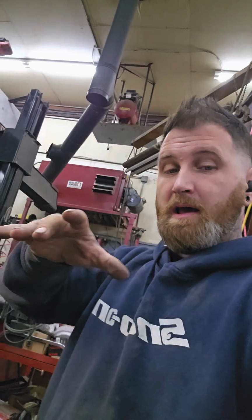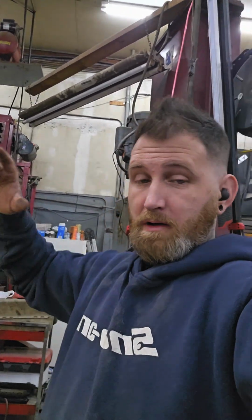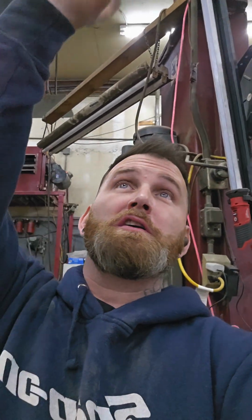Any of you that couldn't tell from the bottom of this engine, this is a 3.6 liter. Engine oil, if it's coming from up top of the engine, it's gonna run down, and as you're driving, the wind's gonna catch it and blow it back further down the line. Drive shaft, your transfer case, etc. So a lot of people can get that confused and think it's coming from a different spot. So that's when you really need to look up above and check everything. Do your due diligence. That is a tongue twister.